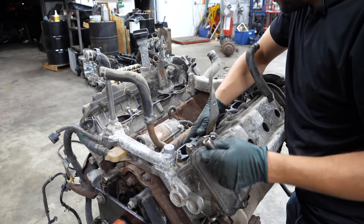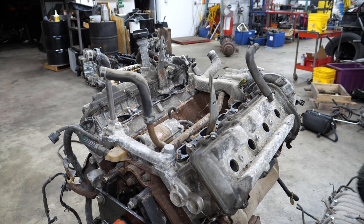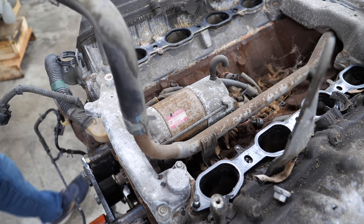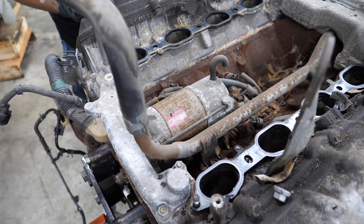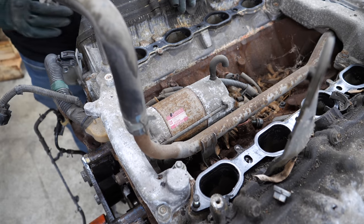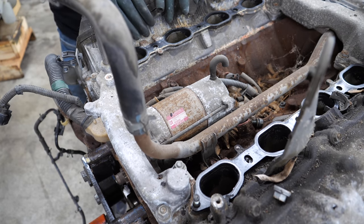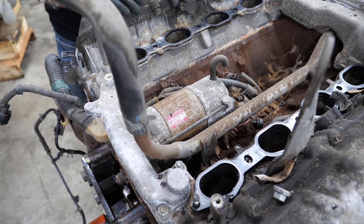All the sockets retrieved. Now I'll show you what I don't like. This is my least favorite part of this engine: the starter location. They put it in the hottest part of the engine, in the middle of the V. It's also relatively inaccessible — you have to pull the intake manifold and buy new intake gaskets to do this job. The bolts look like the least fun part entirely. However, it could be a situation where the starter never goes bad. Maybe I'm just crying over well-done steak.